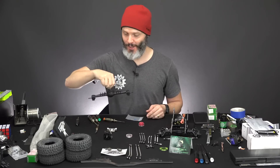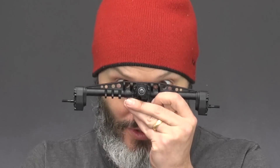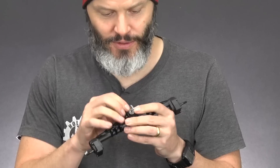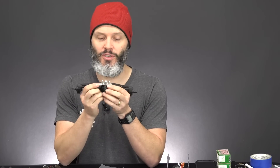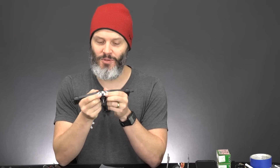Now that we have our axle all bolted together, we can put on our upper link mount. This is the part that Super Shafty makes. It looks like we got these two holes in these axles — that's convenient. It's also got these little moons or full moons that key into those holes, and we just kind of slide it in. That's a well-designed part — kudos to AJ on this one. The old upper link mount holes right here are the ones that retain this part. So it uses the truss, if you will, to key in, and then the old bolt holes actually hold the part. That's pretty neat. Nice one, AJ.